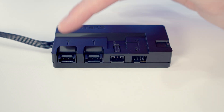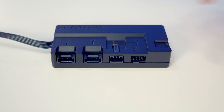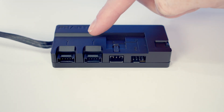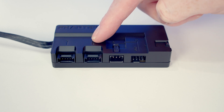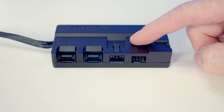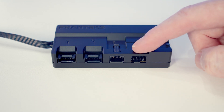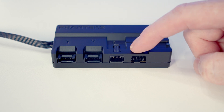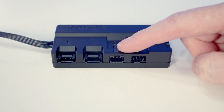Taking a closer look at our hub, we've got three channels: one, two, and three. Into channel one and two we're going to use a single cable from our AIO and a single cable from the case fans we'll install in our power supply surround. That one cable lets us control both the lighting effects on the fans as well as their speed. Channel three is slightly different and offers legacy support, with a four-pin PWM connector and a JST connector — exactly the cables coming from our four pre-installed case fans — so we can control their speed and ARGB effects.